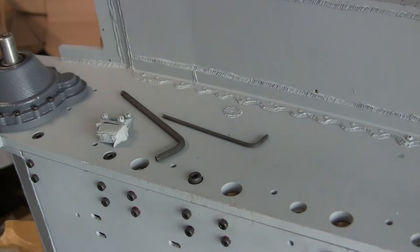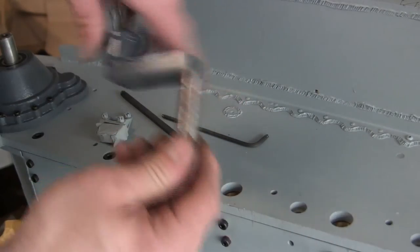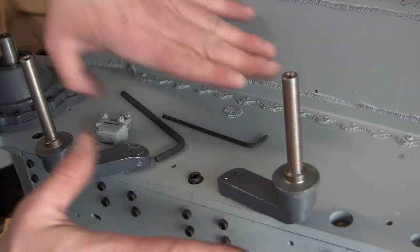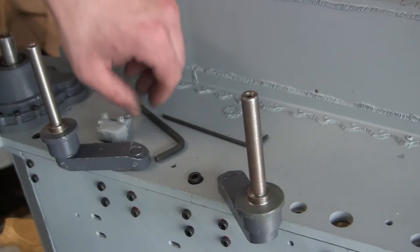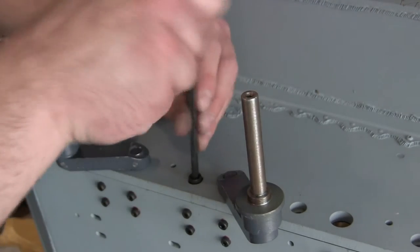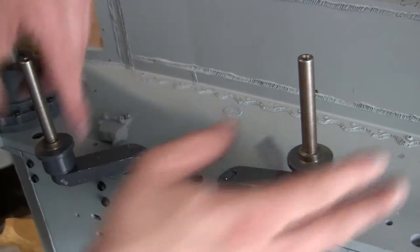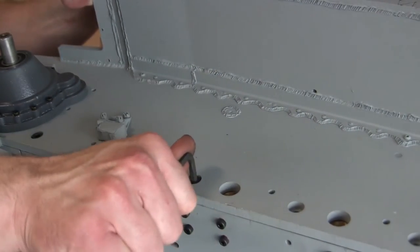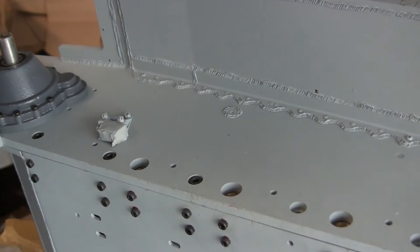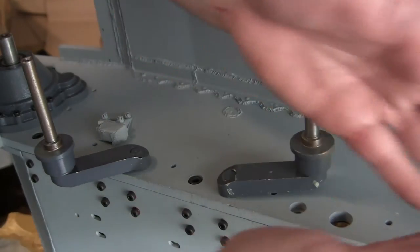As a quick guide to make sure that all the holes are lining up and that the bushings are properly aligned, I'm again using swing arms — I could line it up as well as use a second one to ensure that once all the fasteners are tightened, the swing arms will still be able to move freely. At this time I can start tightening the fasteners. The swing arms are still freely moving, which means the part is in spec, and it can be tightened further.